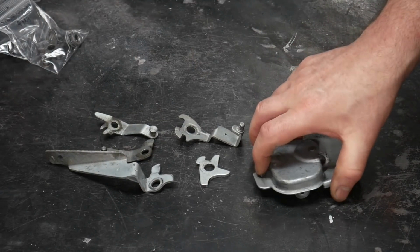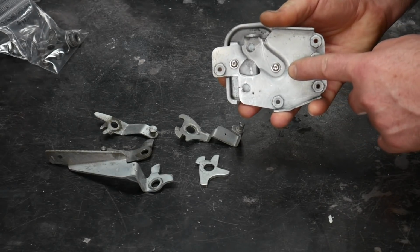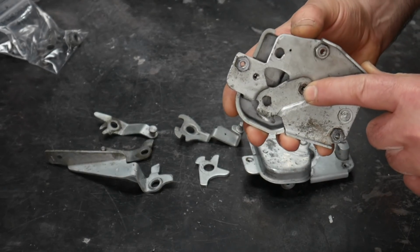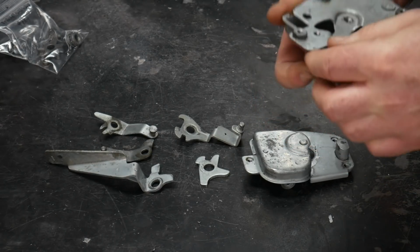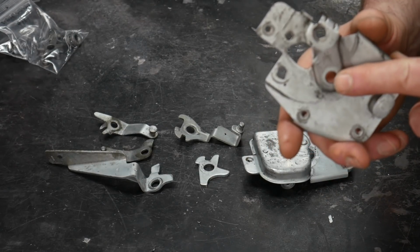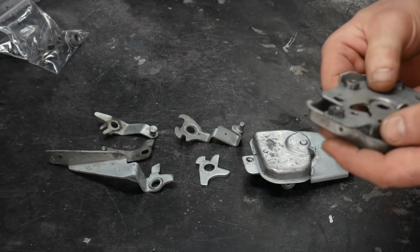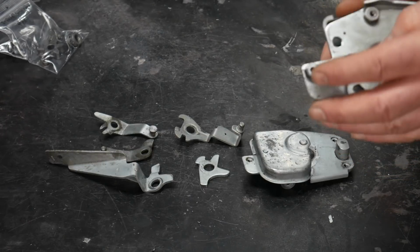They're labeled. But for each one of the spot welds that I took out, I've drilled and tapped them and inserted a screw, right? So I've drilled and tapped them M4 right here, there and there. And I've paid careful attention to the alignment. So you'll see this is not as easy as it looks because there are things like this hole's got a hex, these holes have flats on them to prevent the springs from moving. So you have to be very careful when you put them back together. And then they have to fit together really nicely.